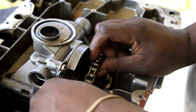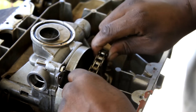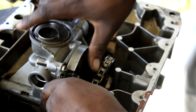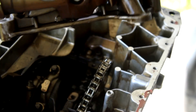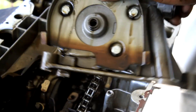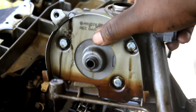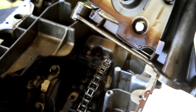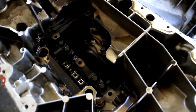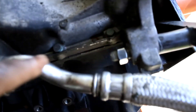It can be a fight to get off — release that tension and you may need a pry screwdriver in between. It's keyed, so it only goes one way. There's a little notch up top — it only goes one way, so you should have no problem. Now I should be able to attack the bolts connecting the lower or upper case to the rest of the block.